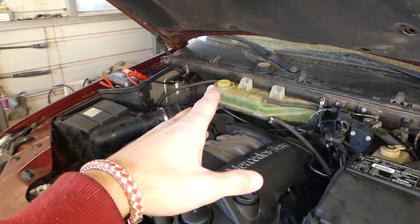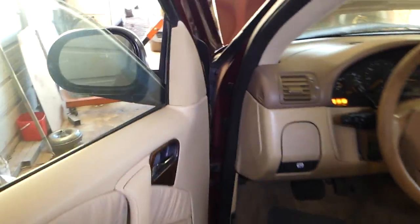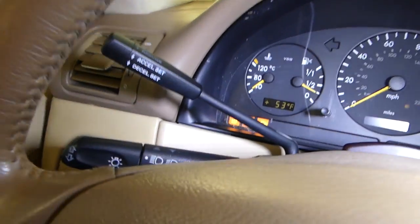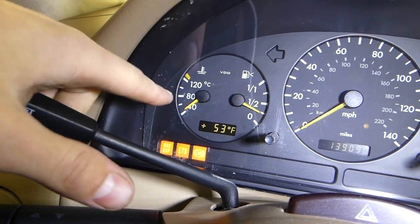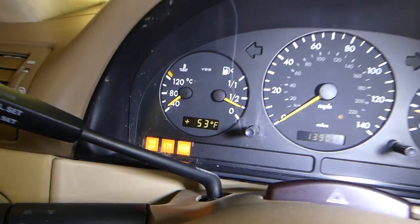Leave the cap open — don't close it. Let it idle inside only if all doors are open for ventilation. You need to idle until the thermostat opens, which will be above 80, probably close to 90 degrees. Let it warm up all the way and circulate at least once or twice. Then check the level one more time. After you drive it that day, check the level again the next morning, because there's still a possibility air remains in the system. Hopefully this video is helpful — please subscribe and see you next time.